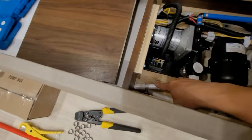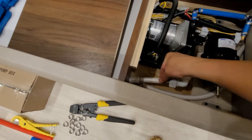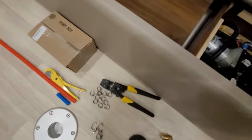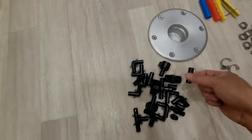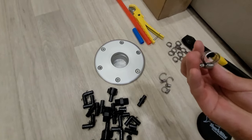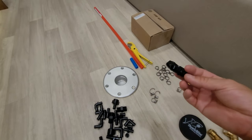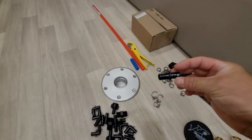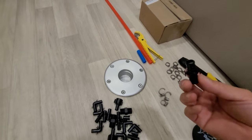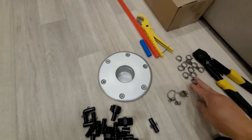Why you want the band clamps is that in the motorhome, besides PEX, there are also white water hoses. If you ever have to cut a factory end off — like here, this factory end is pressed on — if you ever had a leak or this piece went bad, you could literally cut the hose off. In a bind, you could use a PEX fitting with a PEX crimper, though this is not the ideal fitting. Winnebago uses white hose with PEX connections throughout many places, but that's not an approved assembly and you're likely to get a water leak.